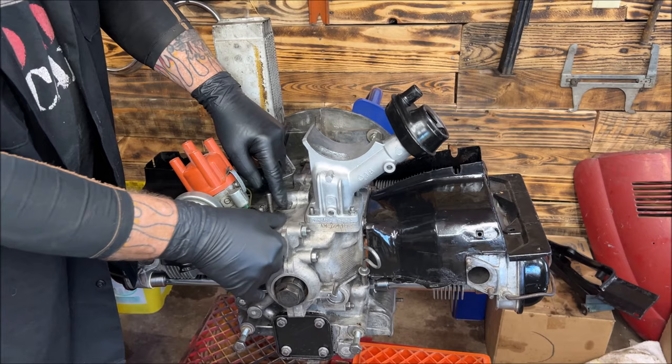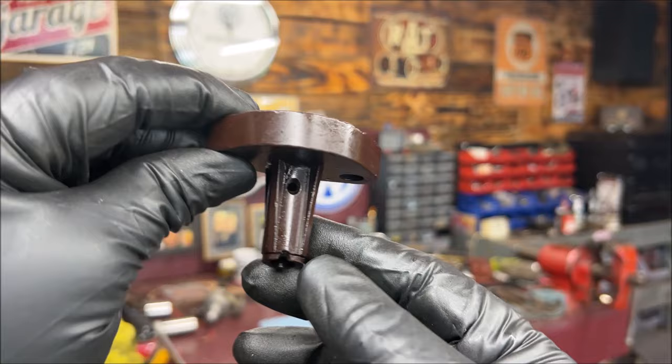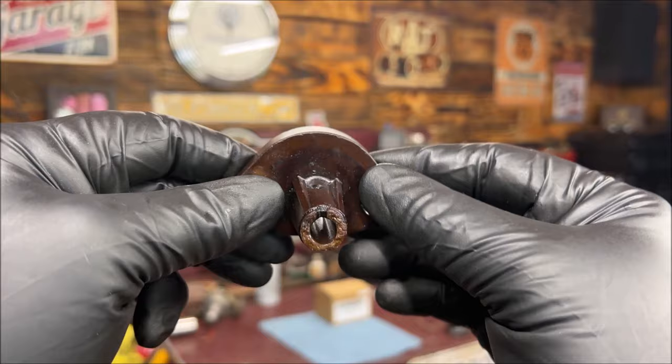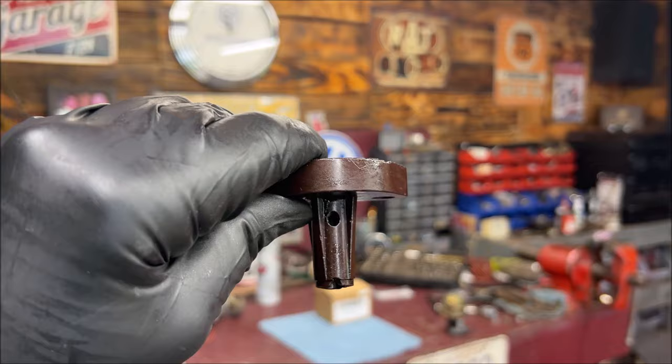Now I want to go over something about this bakelite spacer. You'd have a gasket here, the bakelite just pulls off, and then you have another gasket — you've got to clean this surface up really good before you put the new gasket on. See what happened: the bottom of it broke off. This happens a lot with these — they get hot and get stuck. I had a little luck where I got a tap in there just a bit larger than the piece, ran the tap in, put vice grips on and tapped it. It took about an hour but I finally got it out in one piece, so be careful.